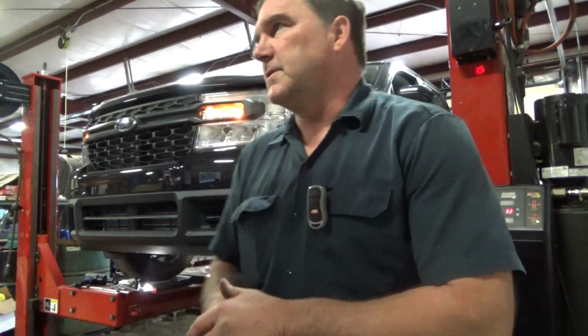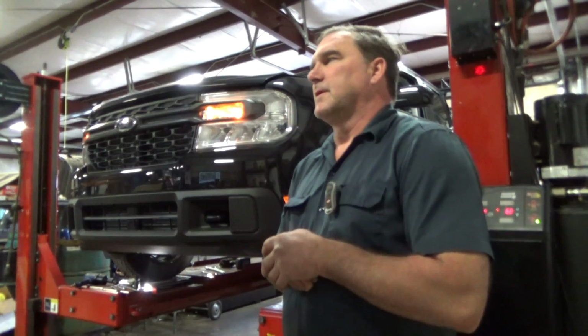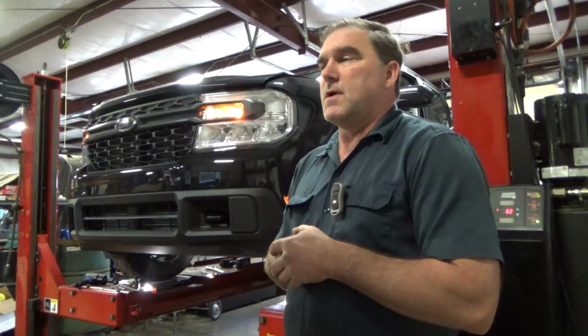And my caster's within 0.2 of a degree. My camber shows within 1/10 of a degree. My toe's right where it needs to be. So we'll strip this thing down. I'll walk you under the vehicle.